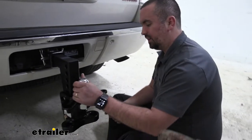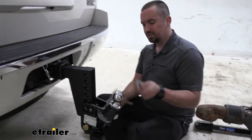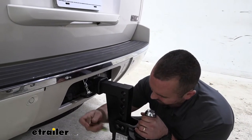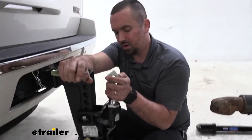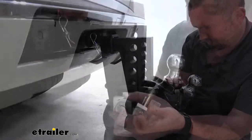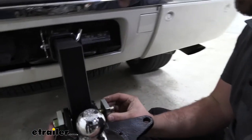Next, we're going to see that we have some tilt here, and this can be adjusted by these grooved washers. This allows you to adjust that tilt a little bit. I've messed with ours a little bit to get that fine tuning in. Once you determine the tilt that you want, we're going to run this through, and these teeth are just going to bite into here. On the back side, put the teeth facing in towards those grooves.